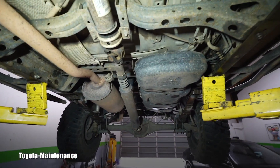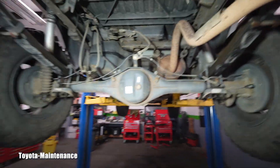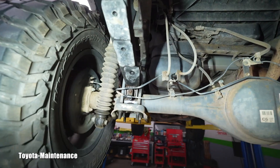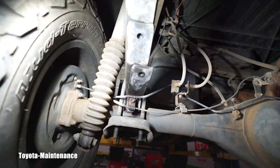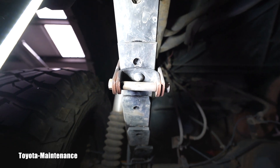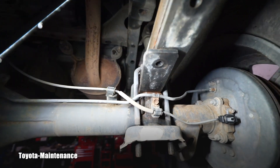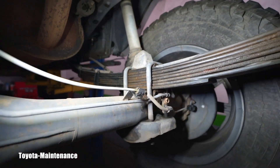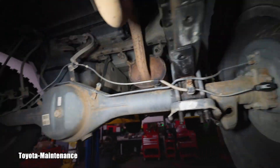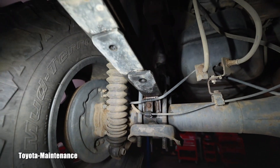The customer said maybe the whole axle shifted right or left. Well, look at the very bottom leaf — it's moving because it doesn't have a clamp to keep it perfectly in place, and that's on both sides. I think the shackles may not belong on this install. Look how much space there is between the shackle and that leaf spring — no wonder the bottom leaf moved.